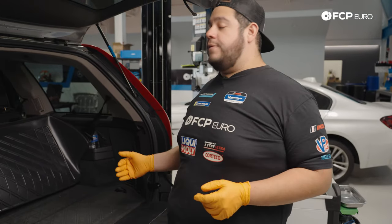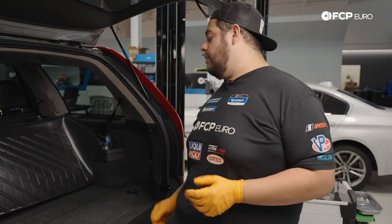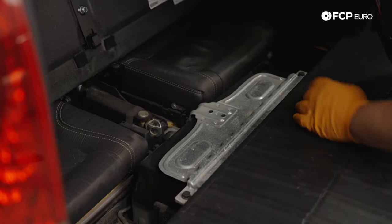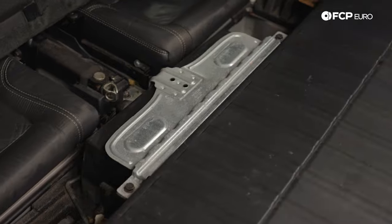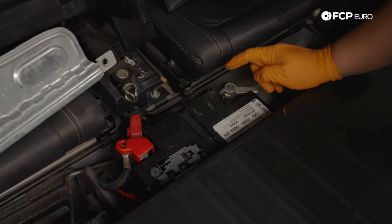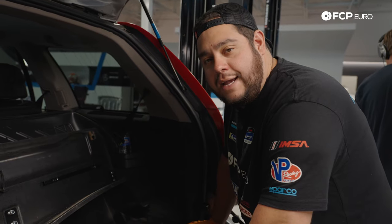To get started we're going to head to the back of the XC90 and undo the battery — just the negative terminal. That'll make sure we don't trip up anything underneath the dash, especially when unhooking and plugging back in wires and resistors. We'll lift up the rear cover, remove the lower portion, then use a 13mm on an electric ratchet to zap out the three bolts holding the shield over the battery box — one on either side and one in the back between the jump seats. Then we undo the 10mm nut without removing it all the way.